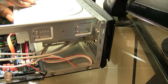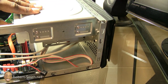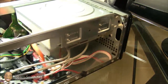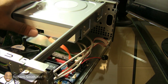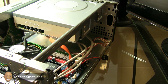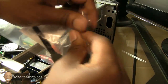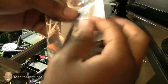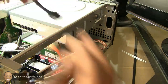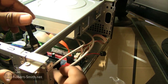And there you have it — that should be enough. It may have screws on the other side for you to screw in, but as long as it's sturdy, it's not going anywhere. Now I can go ahead and hook up the serial ATA data cable and hook that up into the motherboard. Make sure you pick up a small one — I don't need that much cable length from my DVD-ROM bay to the motherboard.